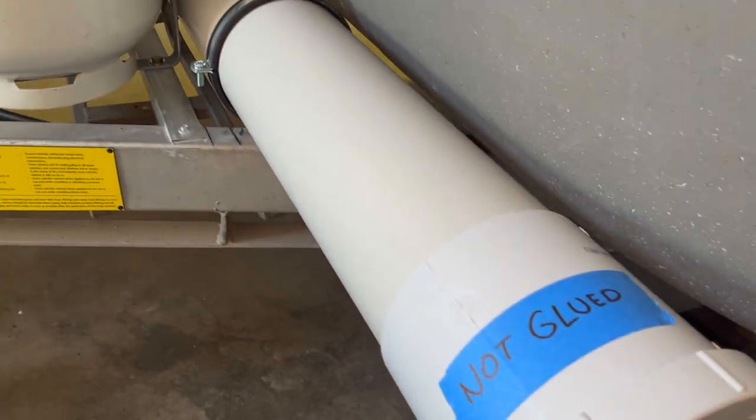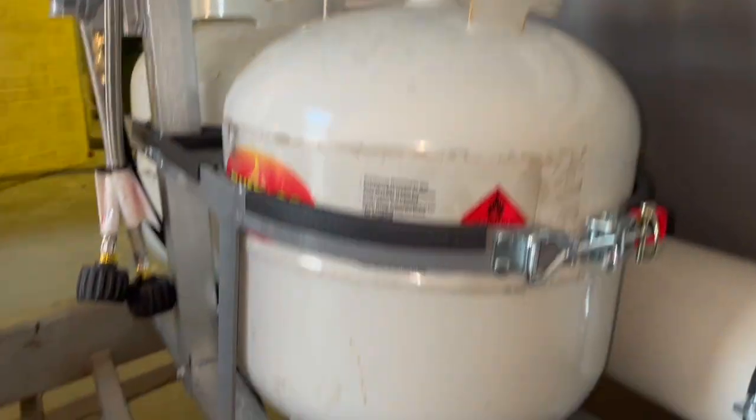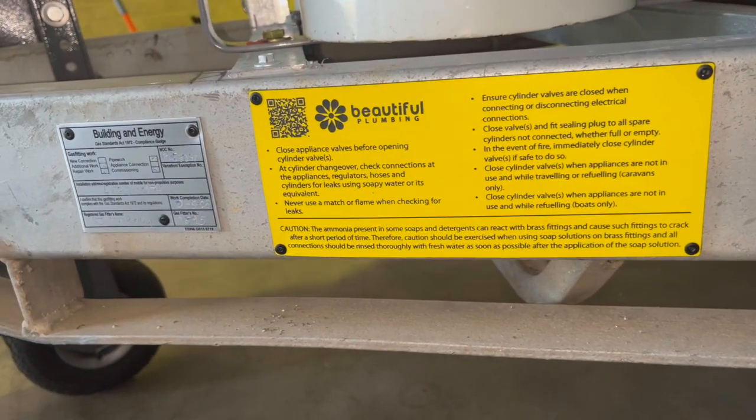The bottles are moved out from the front of the van now, out of the locker, which is good because it's a real pain to seal back to that door - so super safe out the front. The guy also asked if I could make sure there's enough room to fit a 150 pipe in there. I had to bring those bottles forward enough so they could still fit a pipe in. He called and asked me to fit the pipe as well, so I stuck the pipe on with two 150 couplings on the end, made it two meters long. I didn't glue the ends on so if he wants to make it shorter he can just pop those off and cut it. Put all the stickers on inside: the cooker label, LPG badge label, gas compliance label, bayonet label - all those labels done.